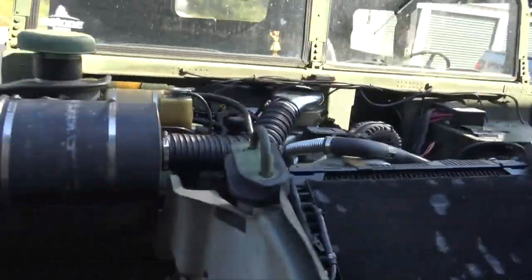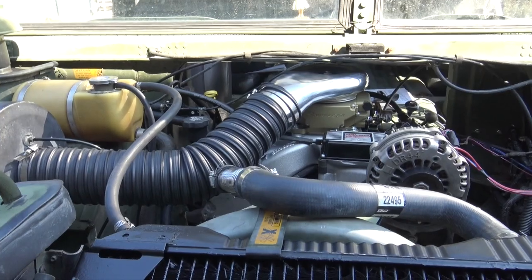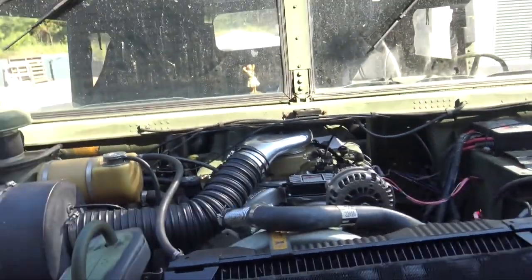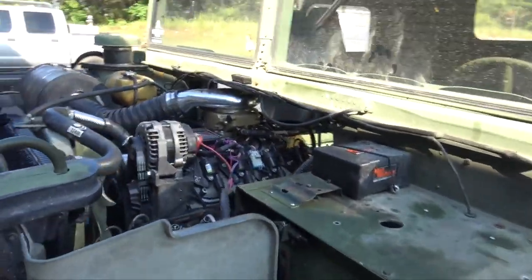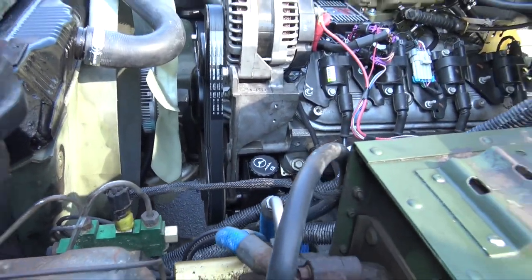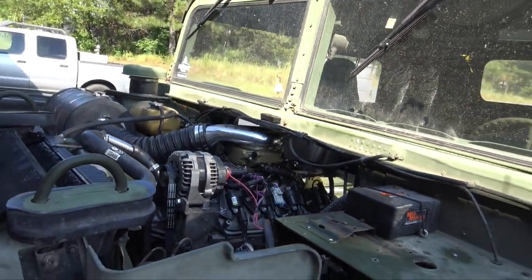Alright, so what did we do today? We got the new hat bolted on, the old school filter taken off, so I can now put the doghouse back on. Got it plumbed to the snorkel — drives great, much much quieter now that the filter isn't sitting in my lap. We plugged the oil cooler lines so they wouldn't dump oil all over the frame and create a smoke show. I bled the power steering — had a huge mess but it's cleaned up. Power steering is much quieter but I'll have to bleed it a few more times. Still moans and groans just a little bit. Way better than it was, but we've got a long way to go.